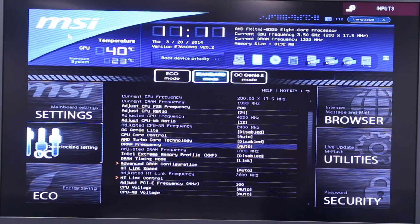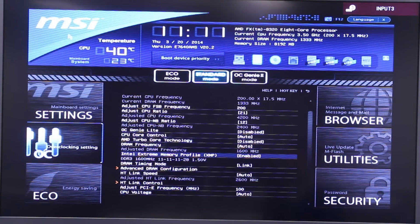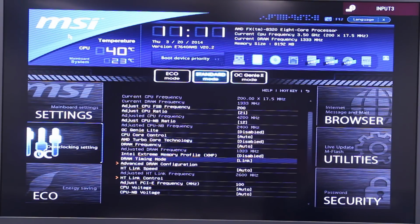DRAM frequency, I put this to 1866 and I'll show you at the end of the video, but if you want to overclock your RAM, I've got a RAM overclocking tutorial. Honestly, RAM overclocking is pretty much identical on the Intels and AMDs, so I'll put my RAM overclocking tutorial in the link below, as I've already spent a lot of time doing RAM overclocking tutorials, and it honestly takes a good 40 minutes, which I keep away. Honestly, quick and dirty, if you've got XMP profiles, you can just enable them. Enable your best profile there, your highest speeds, and that should give you a performance bump over the auto settings anyway.